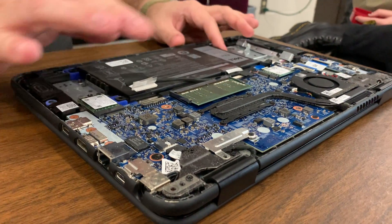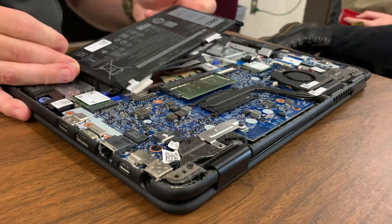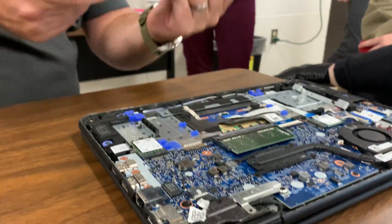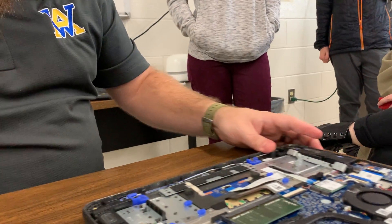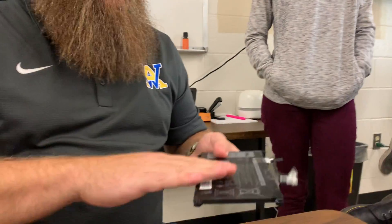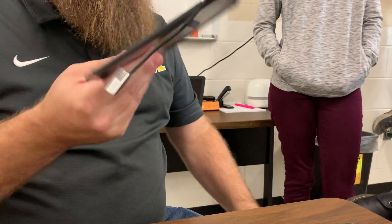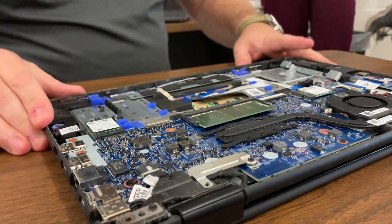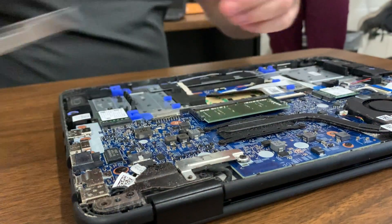Once we get those out, just lift up and slide out of that little rubber piece. There's a pin that sticks up in the middle, so you've got to go up and out — and there's your battery. If you ever see a battery that's got a bulge in it, like it's mushroomed, that's really bad. Let someone know immediately — that's what they do before they blow up.